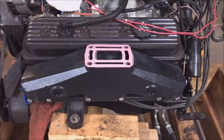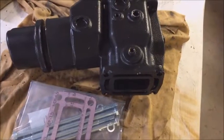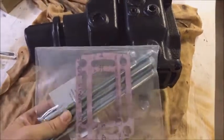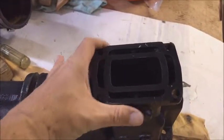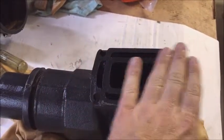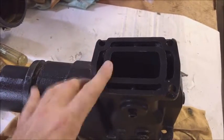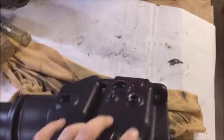Tonight we're going to show you how to get the risers prepped, ready, and mounted on the engine. Here's our new riser, new bolts, and gasket. You always want to use new bolts if you can on these projects. This flat surface area has to go on top of the exhaust manifold. We've got to do the same thing — either file it or sand it down, not just to remove the paint but to get a flat surface so we'll get a good seal and connection between the exhaust manifold and the riser.